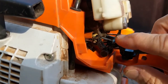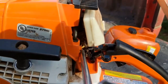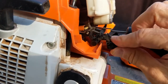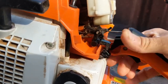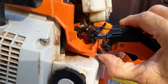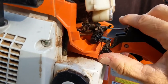And we're back. As you should be able to see now, I have that spring piece sitting on top of the switch mechanism. I'm trying to do this and watch what I'm doing at the same time. So now my choke and on-off switch is working normally — it's working as it should. You pull the trigger to go all the way down to choke, and it'll give you a false start. Once you get that false start, you push it up here, pull the trigger, and now you're in run. And when you want to stop it, everything feels normal — it feels the way it's supposed to.